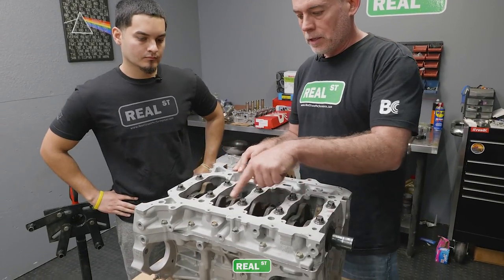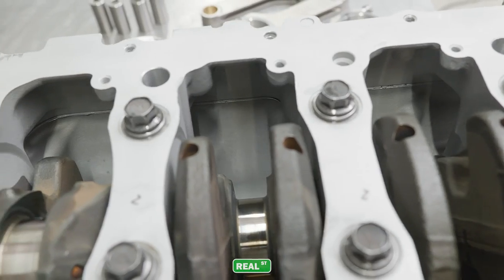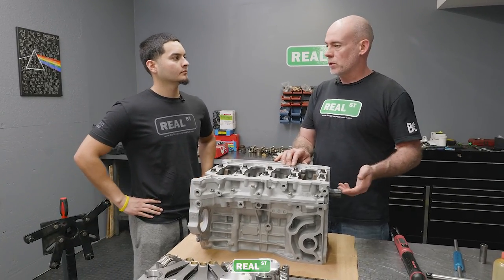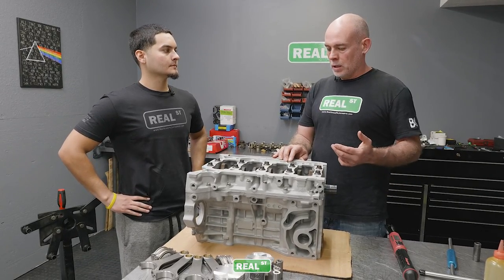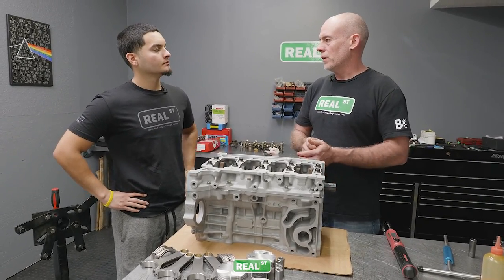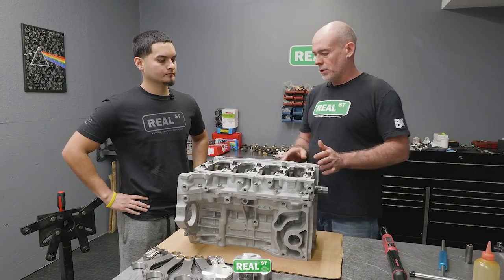Now, if you look inside the engine block, you can see that silicone, how it's just squeezed out a little bit. Oh yeah. That's an OEM silicone that'll stay put for the life of the engine. Where that tube of silicone may be $40, and the one at your average do-it-yourself auto parts store is like $8, buy the good silicone, because there's no excuse to have oil leaks on a modern Japanese engine. Old domestic engines are going to leak a little bit of oil here and there because they have gasket systems that are rooted in the 50s and 60s. But this stuff's good, so buy a good silicone and don't deal with leaks.